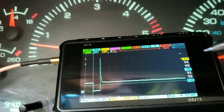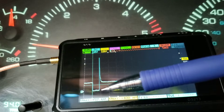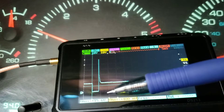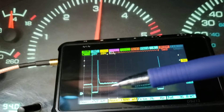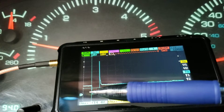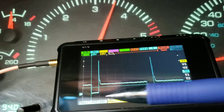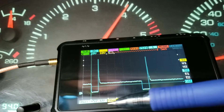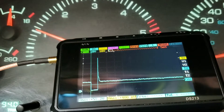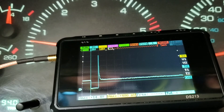You can get an idea of just how long the injectors are being sprayed — there's a 10 millisecond pulse, then it jumps up to a 15 millisecond pulse. You can even see how long it takes for the engine to complete a revolution — you can count those lines. I'll let you count them; you can pause the video. Anyhow, you get the idea. Thanks for watching.